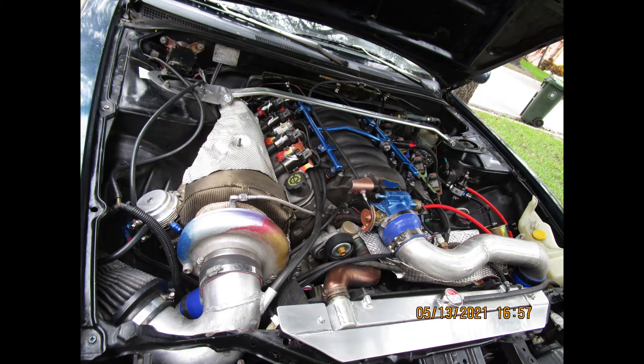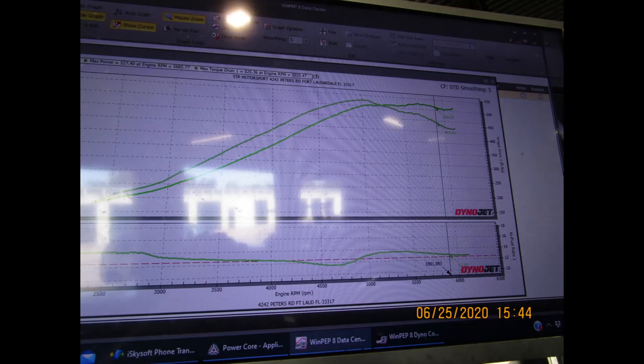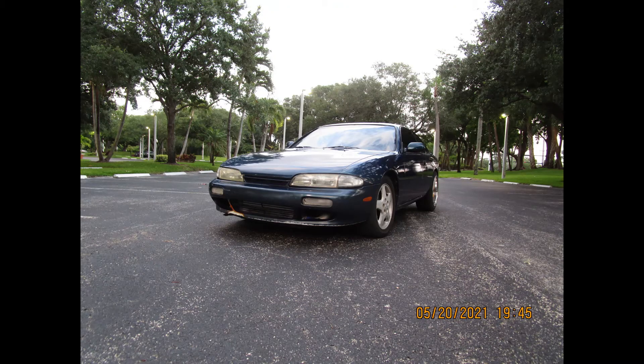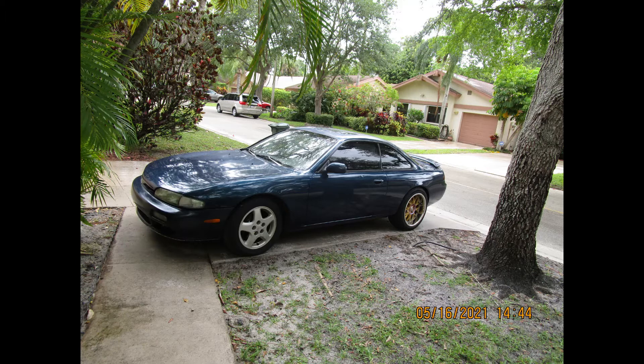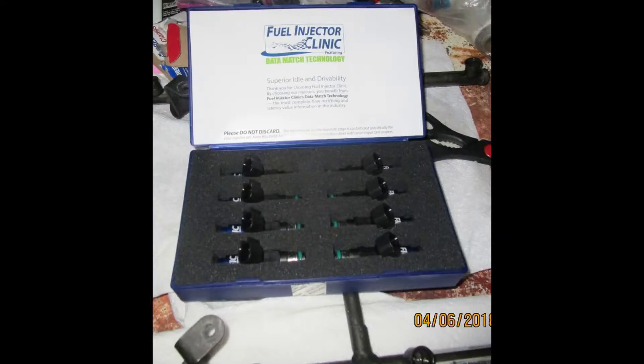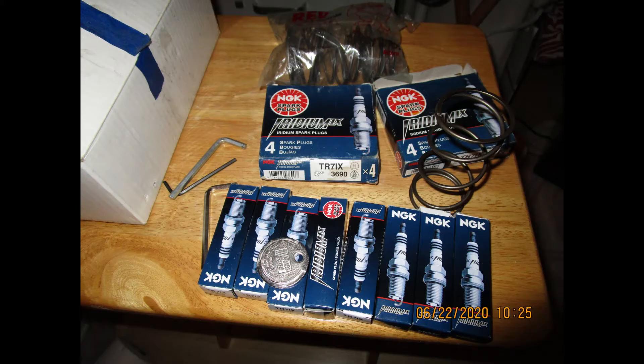My engine has over 200,000 miles, somewhere between 600 and 700 brake horsepower. I drive it every day in traffic — it's a daily driver. I've put over 40,000 miles on it myself in the last four years, and it's never smoked or dripped any oil. The main reason my engine does not leak or smoke any oil is because of PCV. Without the PCV system, an engine will begin to blow oil from the baffle system and leak from the engine oil seals, and it will start to smoke and smell like oil is burning, especially during wide open throttle or deceleration. It takes several thousand, perhaps tens of thousands of miles for the symptoms to develop. The effects build up over time, which is why few people realize the importance of PCV. They will remove it and then notice the engine still seems to run fine and then forget all about it. So you must run some form of PCV on an engine.